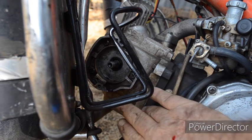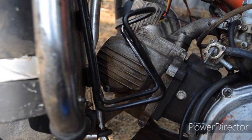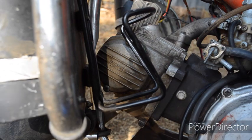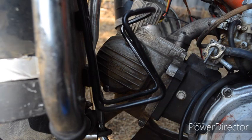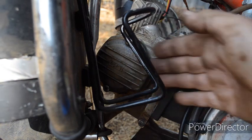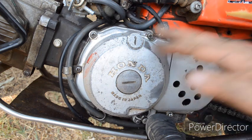When you put the cover back on you just need a grommet in there to stop any dirt getting in. I've put the cover back on — I've used the original cover. The 12 volt bikes have a plain cover, same as what the points bikes have, but I like this CDI cover so I'll leave that one as it is.